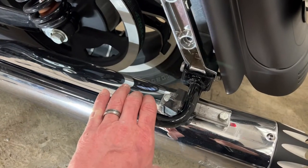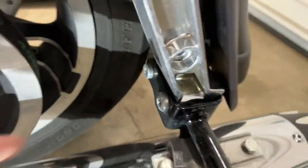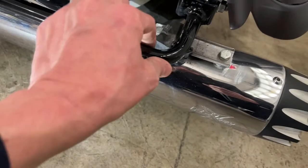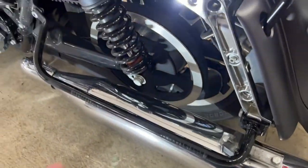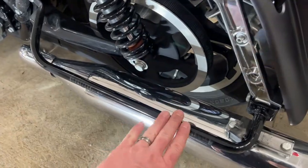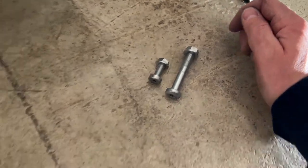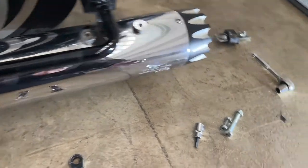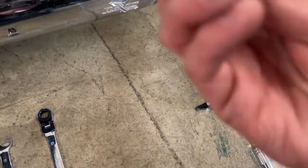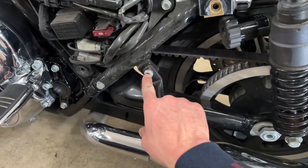We have to take off this bracket here, which is the old factory bracket that goes underneath the saddlebag. It's pretty much only held by two bolts. Let me get those two brackets off. I went ahead and took the two main bolts out — they have two different sizes. The larger one I believe is a T45, and the smaller one I believe is a T40. The one up front is also a T45.